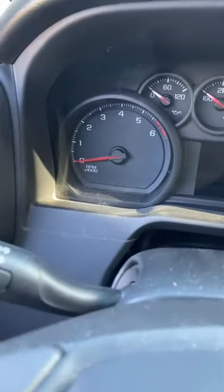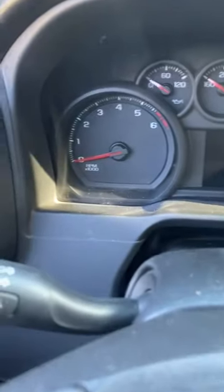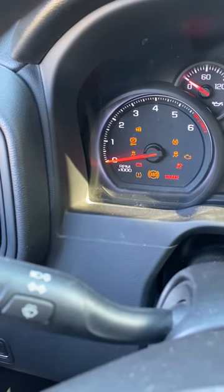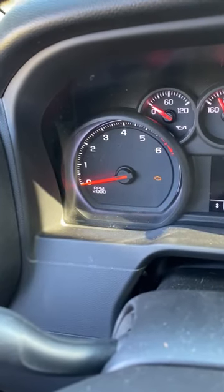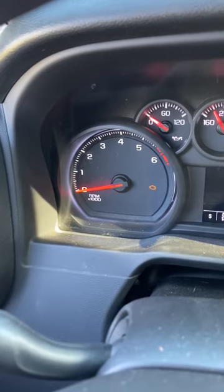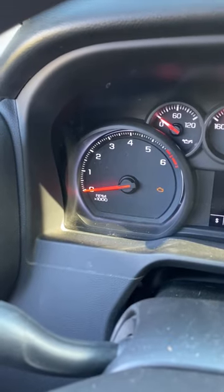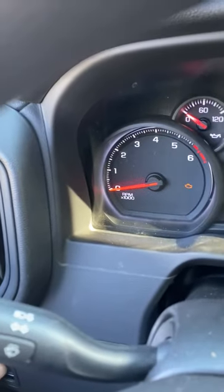So what you're going to do — this is my dashboard, this is the cluster that's important here. I'm going to take my keys, just sitting in my truck right now, and all I'm going to do is key it all the way forward. Not until it starts, but just all the way forward. There's a button down here — this is your parking brake button. Here's the left side of my dash cluster. What we're watching for is a P with a circle around it and a wrench to flash. To get that, you hold the brake down and push and hold the button. My brake's pushed, my button's down and held.